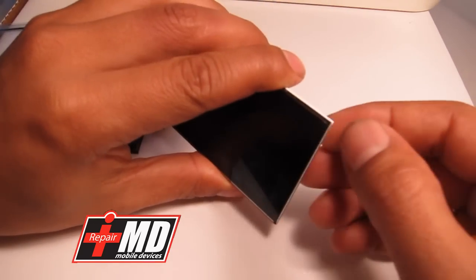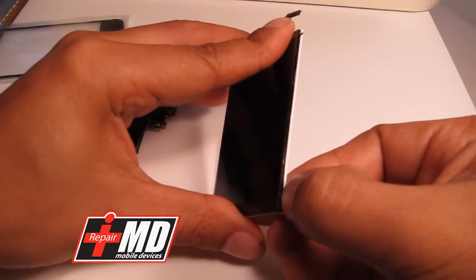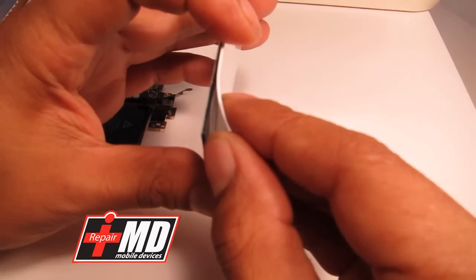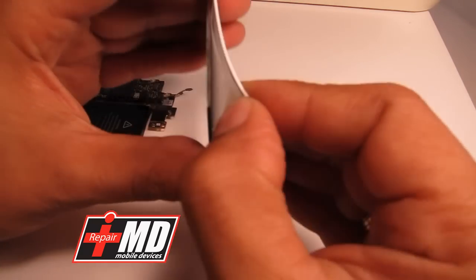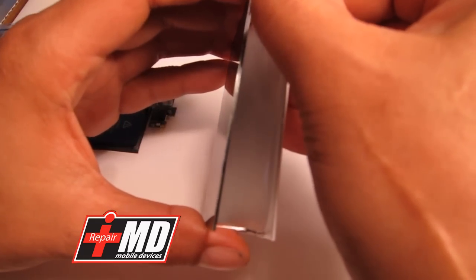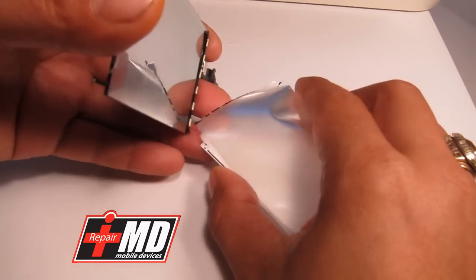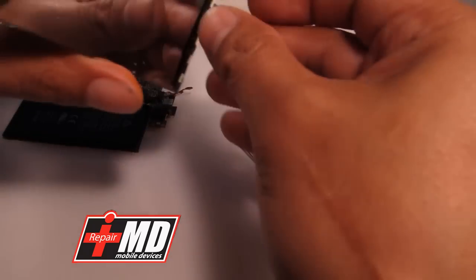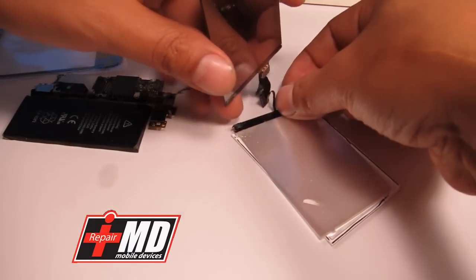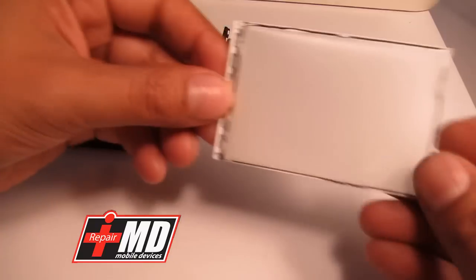What we're going to do is actually just pull the backlight out. Put your thumb around the corner right over here, get the edge, and slowly pull out the backlight. Carefully pull the sheet — make sure you don't damage it. After pulling it out, you'll have this piece right here, which for some of you will be stuck onto the backlight, so just pull it out.